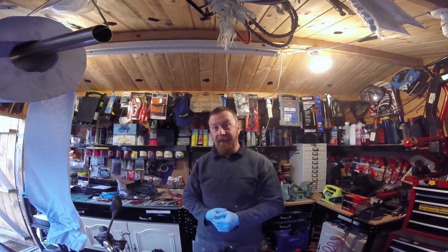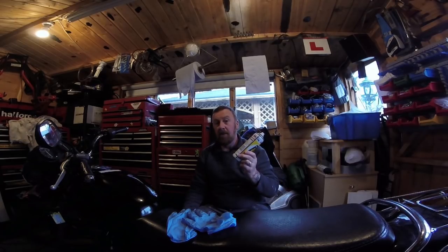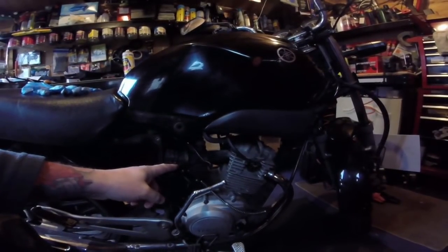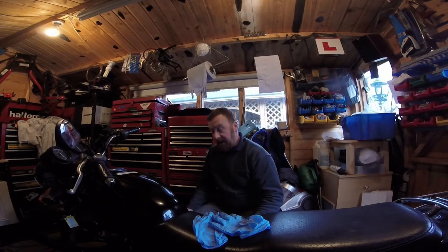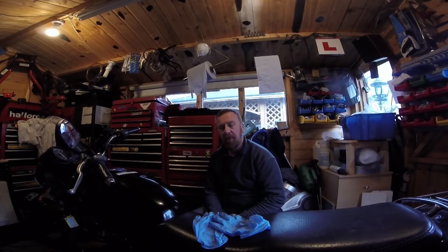Right, got spark, let's get on. So I took the air filter off, bit of fuel at the bottom of it, a little bit of easy start, and she fired up and then died. You know what it is now, didn't you? Don't always assume, okay? When I got this one, there was no oil in it, as you see me filling it up. Spark plug was dirty, also the cap was missing. So basically this has been left in the mobile shop and little bits have been taken on and off of it. But the carburetor, this could have been sitting 6-8 months, I don't know.